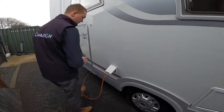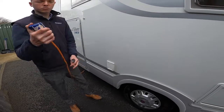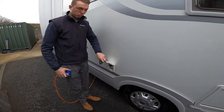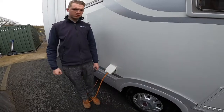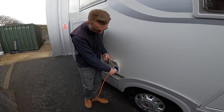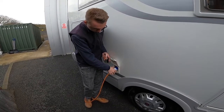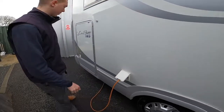Further down the vehicle you've got your mains connectivity point. You get your hook-up lead, lift the flap - always hook the vehicle up first and then hook the other end up to your site. When disconnecting, unhook the site first and then unhook the vehicle by pressing this blue lever on the left hand side down to unhook the hook blade.